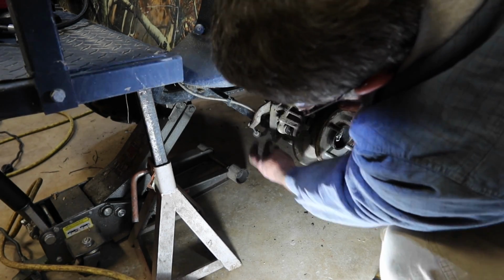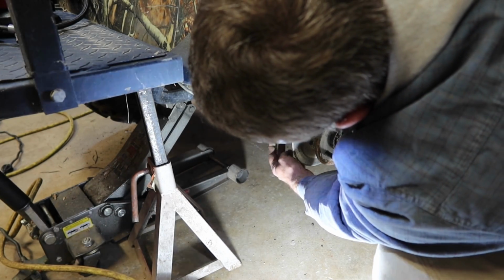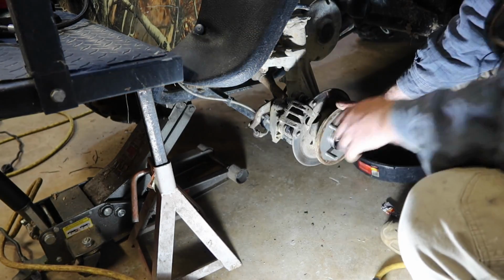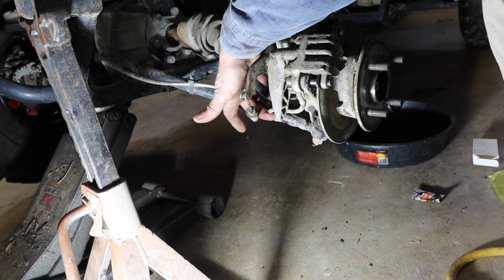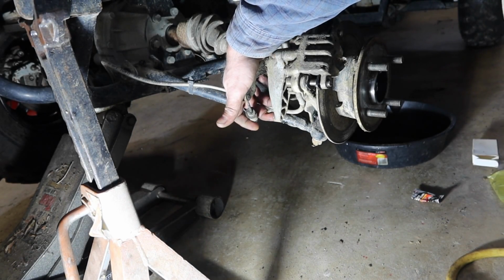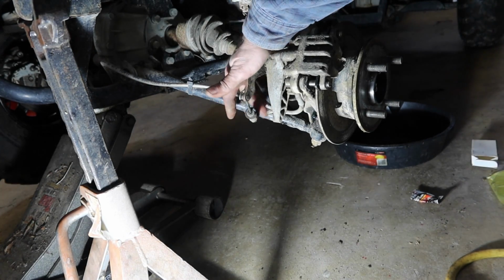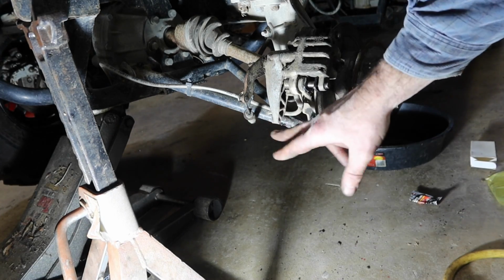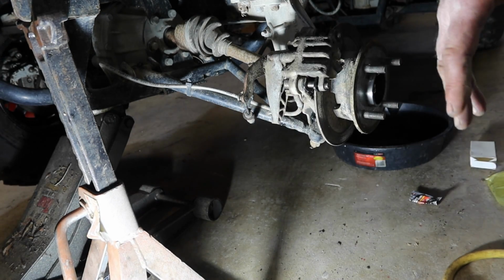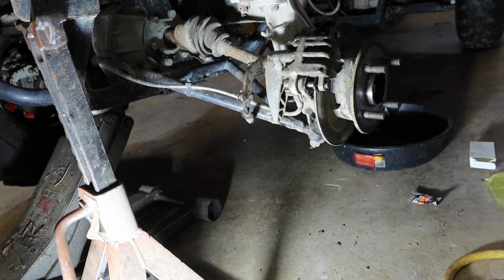Brake pads move. So something I do notice, this side of this caliper is broken off of this. So that's no longer attached. That's probably the biggest part of my problem. This cable right here is supposed to be on this bracket down here, and there's a chunk missing. So this is no longer attached. I'm very likely going to either make a bracket to fasten this back on there, or see if I can order replacement calipers. So this strut doesn't bounce around like the other side does.